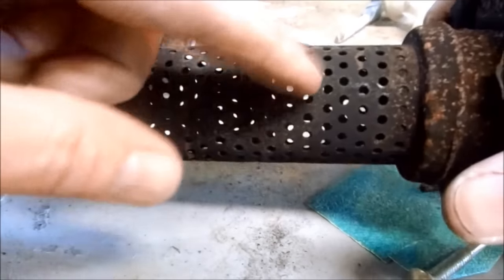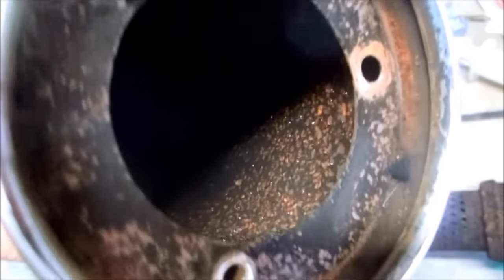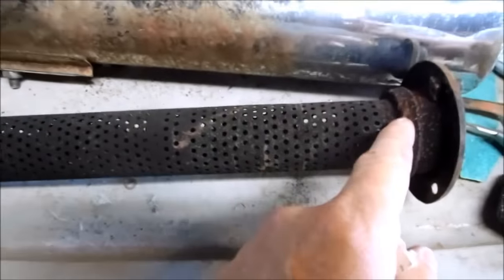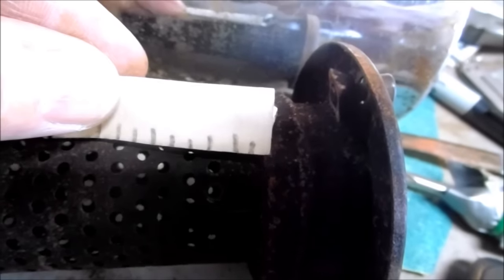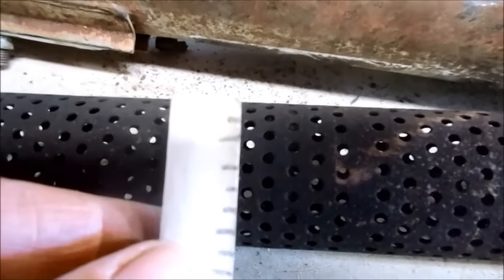So that's the baffle, and this is supposed to have a packing material around it. Inside of the muffler is pretty clean, I'll just hit that. The fiberglass packing needs to go from here to here around the baffle, and the thickness is basically the depth of this shoulder. Thirty-six centimeters, four centimeters — so I just need to calculate the circumference.